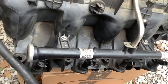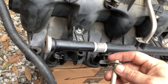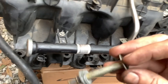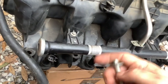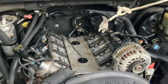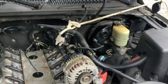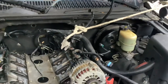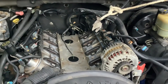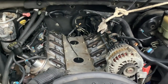I went ahead and pulled all the retaining bolts from the manifold before I reinserted it into the engine so they didn't get hung up on anything. There are ten of these bolts — five bolt holes on each side. If you're doing this job alone as I am, you want a lot of clearance when you put the intake back in. What I wound up doing was taking a small length of rope and tethering the wiring harness up against one of the hood springs so I could move the intake right in without compromising movement or breaking any wiring harnesses, particularly the one that goes to the knock sensors.